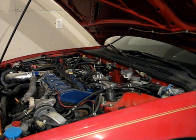Otherwise, just read really carefully at your local auto parts store and make sure you're getting something that's a pretty pure mix. The one that this car would use, I believe Honda refers to it as Type 1, but if you just talk to the parts clerk, they'll be able to use the computer to look up the right stuff. Honda antifreeze and coolant is a little bit more expensive than a lot of the stuff that you'll find in the auto parts stores, but I think for the frequency that you change it out, which doesn't happen that often, it's money well spent to get something that's designed properly for the engine. So I'll go through it step by step, and thanks for watching.